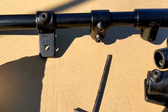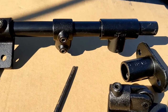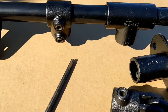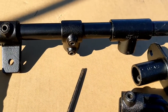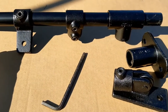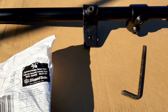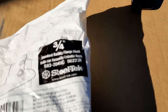If it's not structural — if it's just visual or cosmetic — you could get by with just Allen screws. I'm planning on using it structurally a little bit. I'm probably going to be mounting the steering column with it, with some additional bracing, but I'll have it all tied together so I can mount some sheet metal to it and still have it visible. The plan is going to evolve as I figure it out, that's for sure.